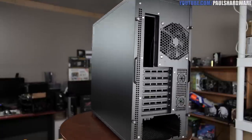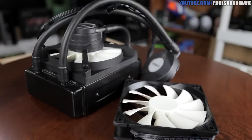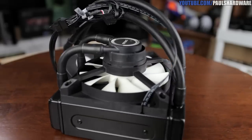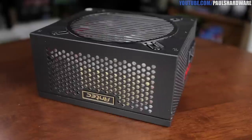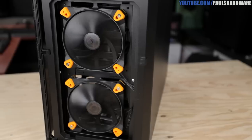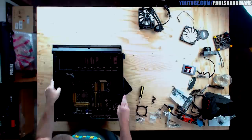The last four items are all provided by Antec. The case is the Antec P100 — it has all the foam padding and rubber mounts I mentioned. The CPU cooler is the Antec Cooler H20-950, which is probably the most controversial choice — I'd generally go with an air cooler for silence. However, turning the fan speed down with the Asus utility dropped the volume significantly, and the pump noise was minimal. The power supply is the Antec Edge 650W — one of the quietest fans I've heard outside the premium 80 Plus Platinum range. The fans are Antec's True Quiet 120mm case fans with rubber mounts and a built-in two-way switch for 600 or 1000 RPM operation.